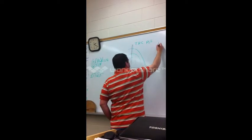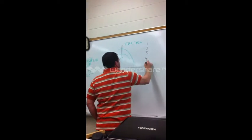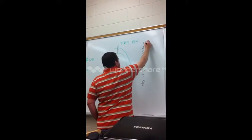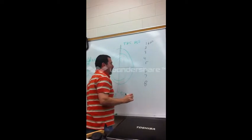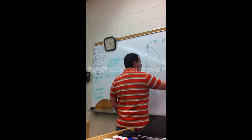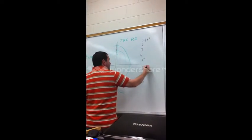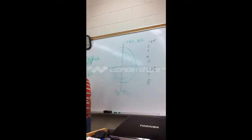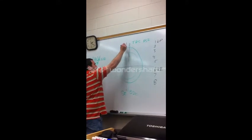So firing order: 1, 2, 3, 4, 5, 6, 7, 8. Number one is coming down on power. What's number one's mate? Six. What's it doing? Intake. Coming down on intake. So I put number one here.